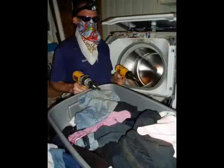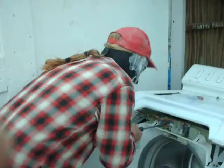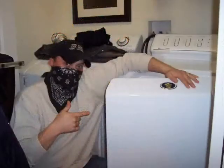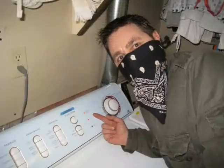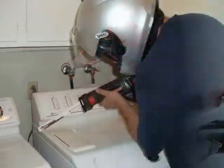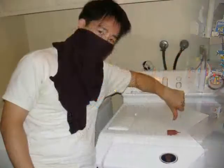NEPTUNE HELP.COM. The door latch wax motor finally choked, Q6R11 on the PC board smoked. NEPTUNE HELP.COM. I found a better way — you can prevent your control board failure by proactively replacing your wax motor.